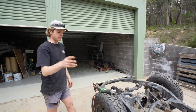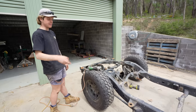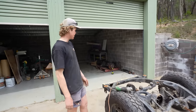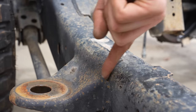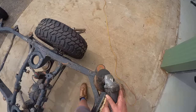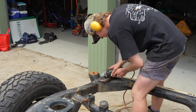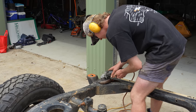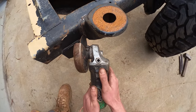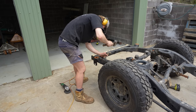I'm going to cut off the back wagon mounts — obviously we don't need them. We'll need the front three so the back two are getting cut off. I've got the grinder, hammer, and cold chisel and I'm going to cut the welds, then with a bit of persuasion from the hammer they should just peel off. Whenever you are cutting things off your chassis, make sure not to go into the chassis itself — you don't want to leave any scores or marks because they will affect the structural integrity and could be a problem if you have to do any engineering.